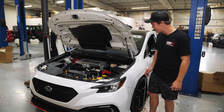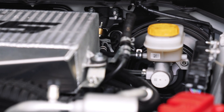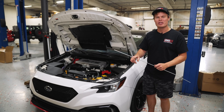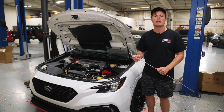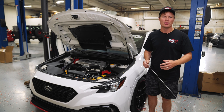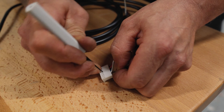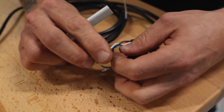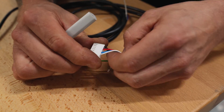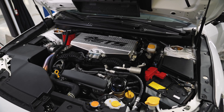The process of snaking that wiring harness through the rubber grommet on the firewall was kind of annoying, but one tool that helped was this hard line — I taped the wiring harness to it and then stuck it through, which made it pretty easy. You can also use a coat hanger or anything you've got laying around the shop. We're actually going to do an additional step and de-pin the harness so we don't have to make a very big hole in the rubber grommet, but alternatively you can just make a bigger hole through the grommet and run your harness through that way.